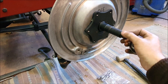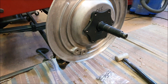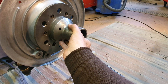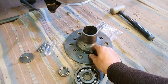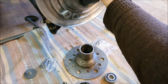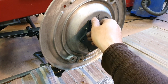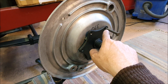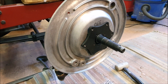The nut goes on to tighten that up with the split pin hole, and then you put the little bearing in place. The shaft where it's been knocked up on the end just needs a little dressing so it'll be a nice push fit. Then you push the hub on and 5/16th BSF bolts — short ones, which I don't have so I'll need to get some — go through the hub and screw in there. These obviously need to be short enough that they don't go all the way through and touch the brake back plate.